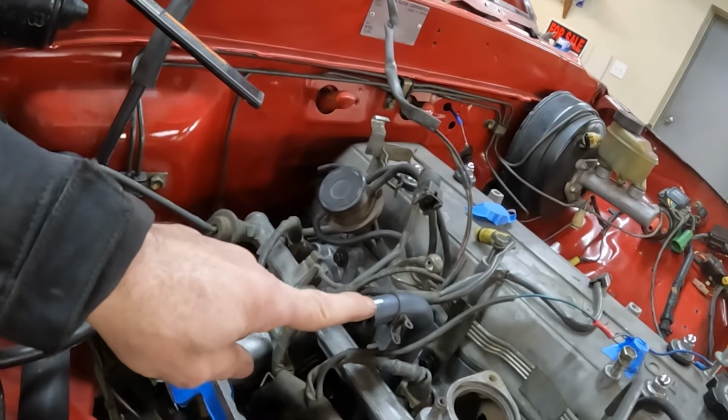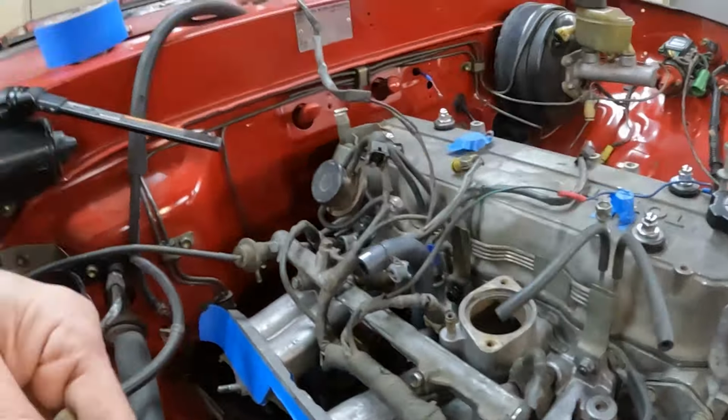All right, so the drive shafts are in there and they're done. We're ready to go there. I've just been messing around with the engine harness routing here and getting that all squared away. And then while I'm here, I'm going to go ahead and get the thermostat in. I'm just getting the IAC hoses dealt with and stuff. So this is your idle air hose. It just runs down to the IAC that's tucked down there.